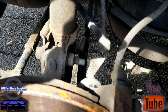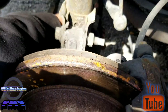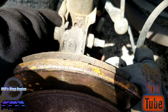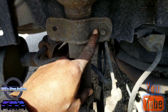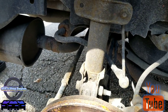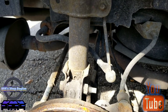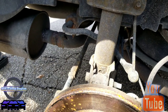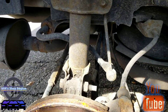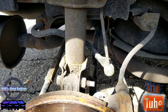Now that we've released that very long bolt, this end is free — as you can see the strut moves, everything moves. You may want to release the sway bar link right here — it's like a 15 or 16. Now we're gonna go up under the vehicle and lower the subframe. I may remove the exhaust but I may not have to — we'll see — and drop the subframe down to get this changed out.